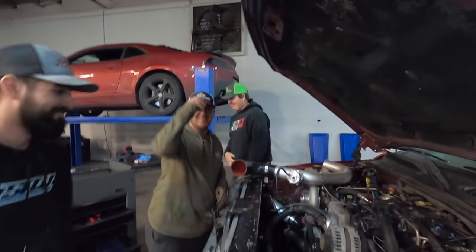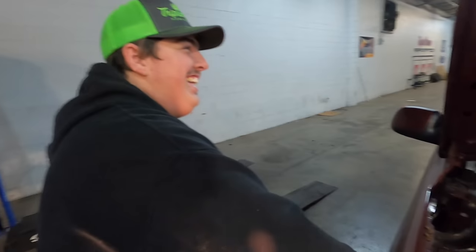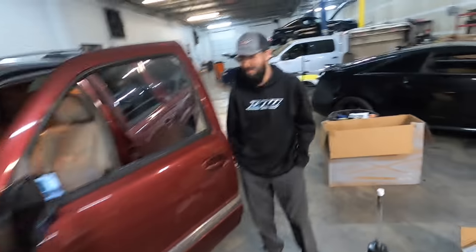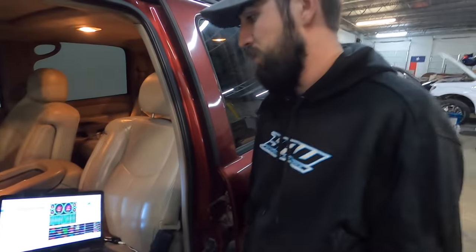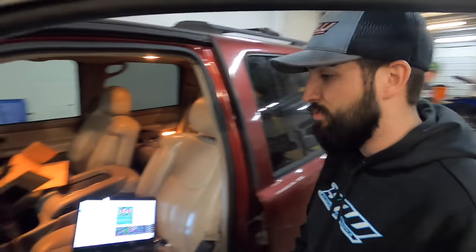That's what all the boost is going to sound like. We're ready, it runs again! It looks good — we're trimming fuel perfectly, no more mass airflow, the twos are working. Ashton gave me one — it didn't look the same as the other one but the plug was the same so I sent it anyway. It looks good, it's trimming fast. We're good for the dyno now. Once we get it on I'll make a small pull, see where we're at, and adjust fueling from there.